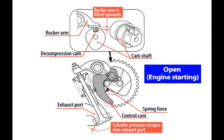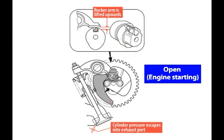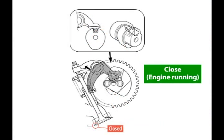A simple and reliable centrifugal cam inside the camshaft keeps the exhaust valve slightly opened when the engine is not turning, to reduce the pressure of the air compressed by the rising piston. As a result, the rider can start the engine with less effort using the kickstarter.